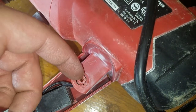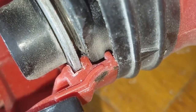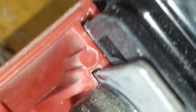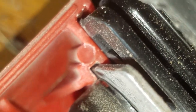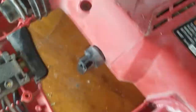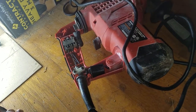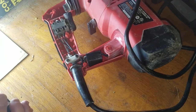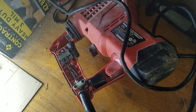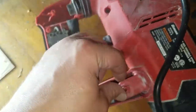The only part that would move is whatever spacing is in between these parts, and as you can see it's already started to partially damage that. You can see the wear marks right in here, and this may actually cause a failure later on. You can see the damaging of the plastic — similar to what you get on impact sockets. That's why a lot of times I don't use impact sockets over thick-wall chrome vanadium sockets, because impact sockets are made to be soft and that's not a good thing. These will be the wear points on this machine.